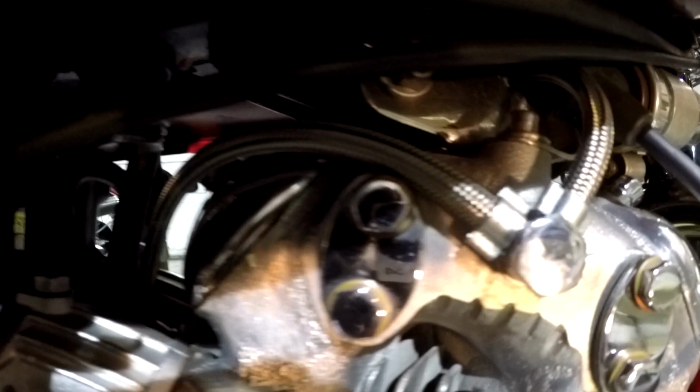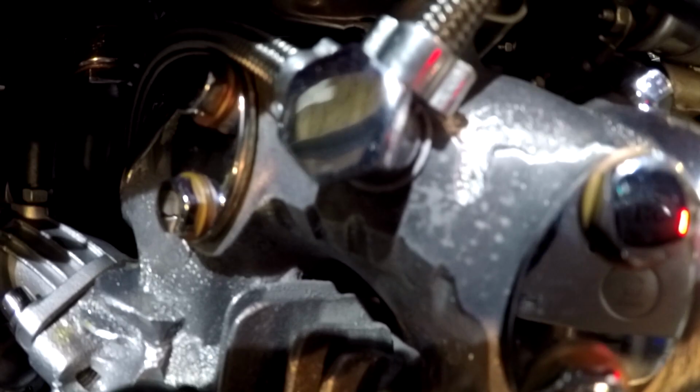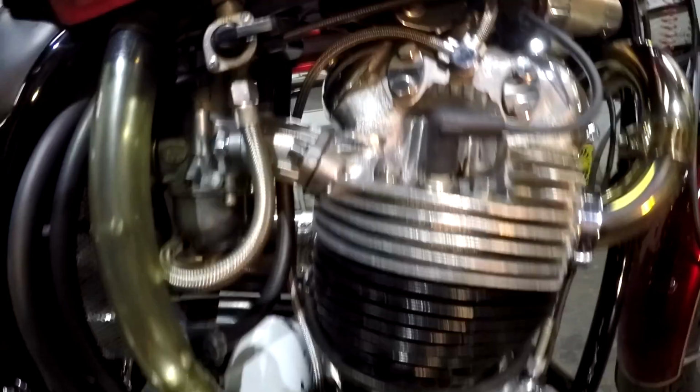This stainless line here is inexpensive, Teflon with stainless sheathing for the pressure line up to the top end. And these simple clips that you crimp, this is very inexpensive. I recommend this stuff here. It has to be sized perfectly to the factory fitting. Now they sell kits for this stainless, same stainless line with these huge fittings. I don't appreciate those. So this motor: single squish, D-shaped Harley style Porsche designed combustion chamber.